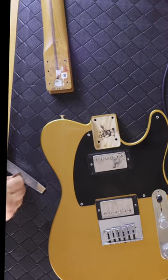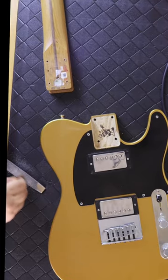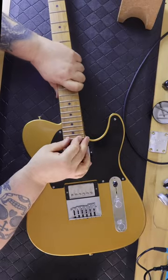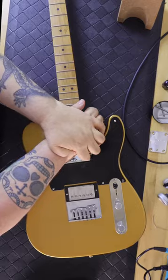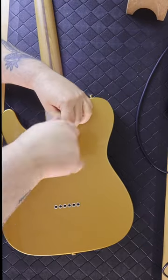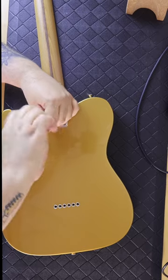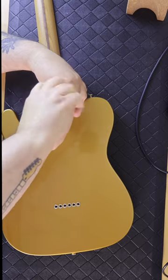Normally for a problem like what I have, you'd use the 0.25 or 0.5 degree shim. All the reading basically said to start with the 0.5. I put it in and it was kind of a tight fit — I couldn't get it all the way back. So I took a file and slowly took off material until it fit in perfectly.